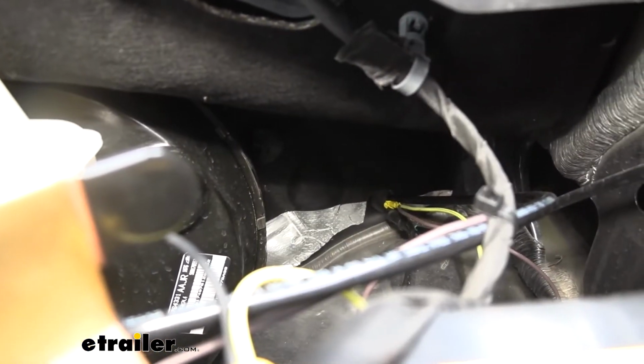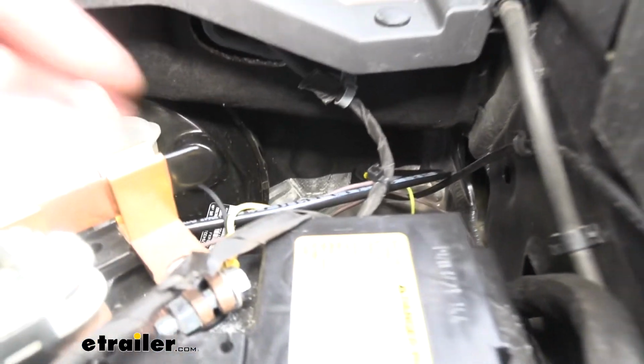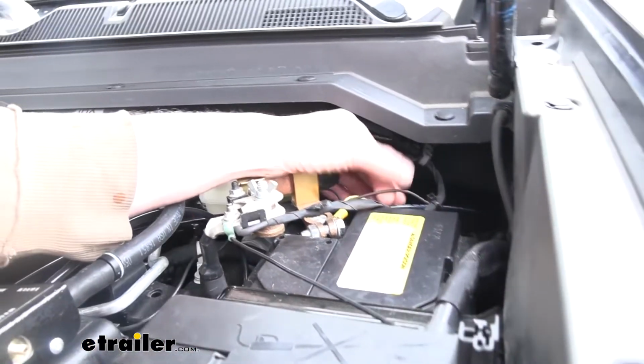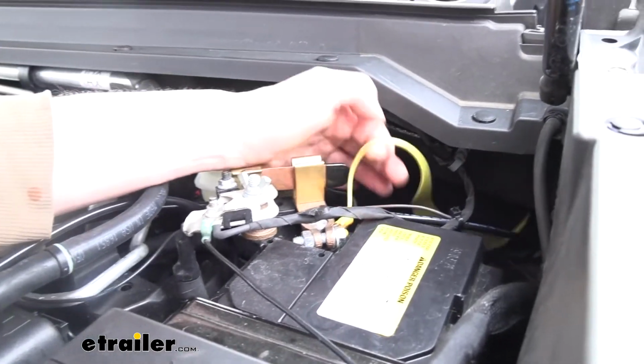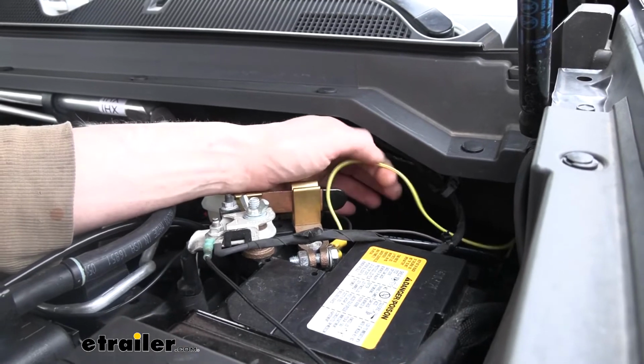We're now outside the vehicle, and what we're looking at here is the other side of that grommet that we were just discussing. We're just to the right of the brake fluid reservoir, and there's a little pocket here that we're looking down, and that's exactly where you're going to see that grommet. So our Airline hose right here routes up. The brown wire that we routed in also routes up. And then if you're hooking your ground side directly to the battery like we did, you'll want to route that up here to the battery as well. But again, you can normally route this to the frame.